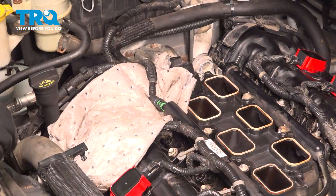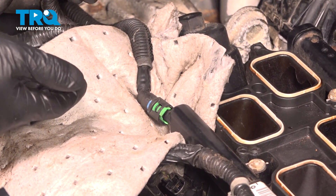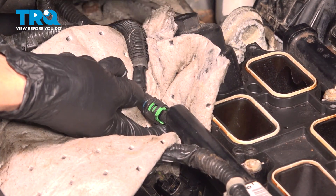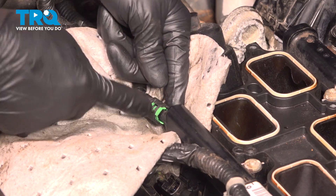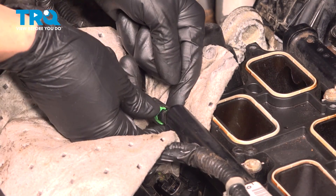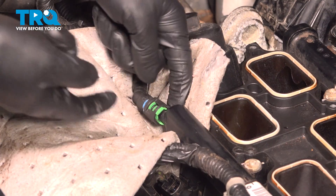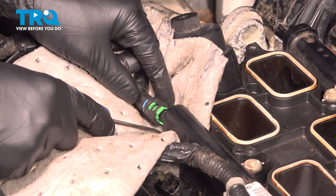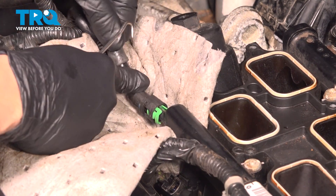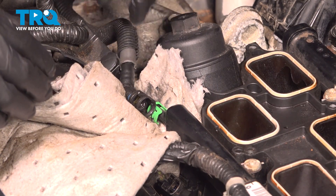Now take this foam off. I'm going to unplug the fuel rail feed line — we did already relieve pressure before we started everything, so there should not be a whole lot of fuel coming out of this line. Keep in mind, there still will be some that leaks out. You're going to want to squeeze this green connector, push the line in, squeeze the green connector, and that should allow you to release the line off the rail. The part underneath is a little tricky — I'm going to use a pick to help press underneath there. Minimal fuel is spilling.